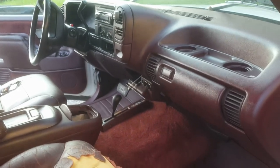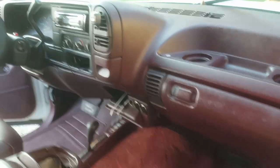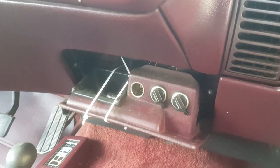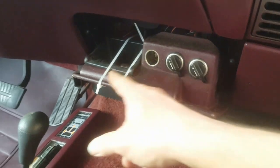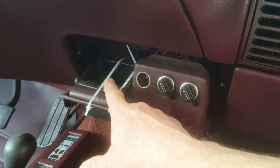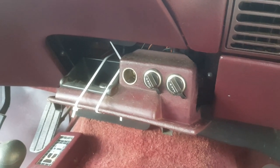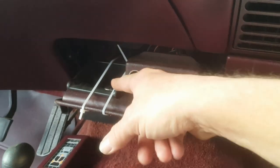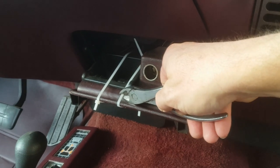As much as I like things that are zip-tied back together — like this ashtray — I guess I will see if I can fix this. It's not for me, it's for the people that ride with me. I went over and took the fuse back out for the cigarette lighter, so if something goes wrong here it won't blow the entire vehicle up. And you notice that when they put zip ties on there, they zip-tied the ashtray itself into this assembly so you cannot get the ashtray out without taking the zip ties out. Let's take this apart with my side cutters and see what happens.